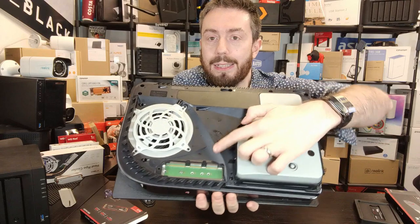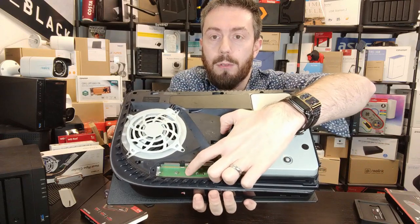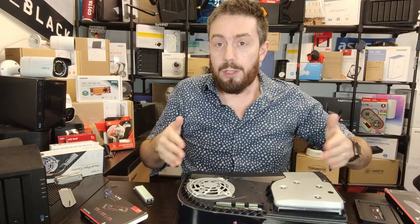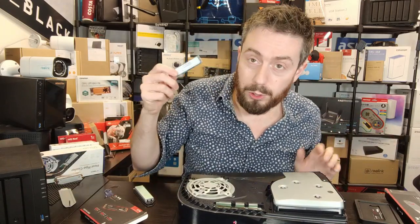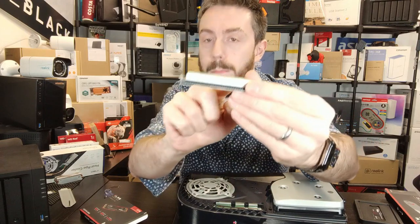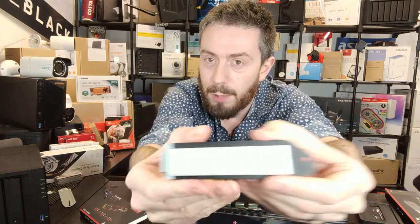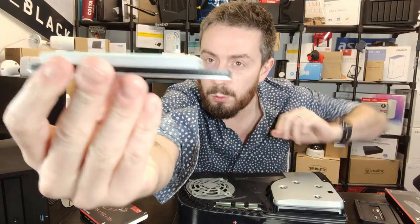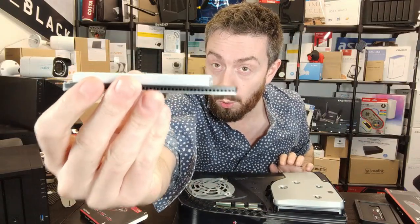The holes there at the base there, you can see, correspond to different length SSDs there. So if you were down the line to get a larger SSD that was cracking outside of the traditional 2280 length and go to the longer ones for more storage, this is going to not only cover that whole thing in terms of the thermal pad, which is a full-length thermal pad there, sorry about the lights going nuts, but on top of that, it's also tall. It's a very tall heatsink.